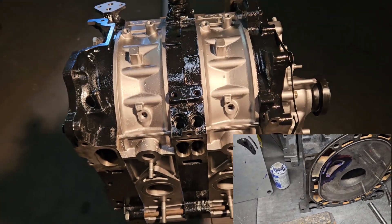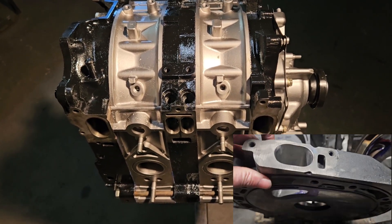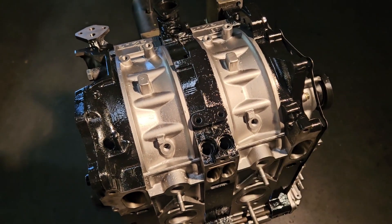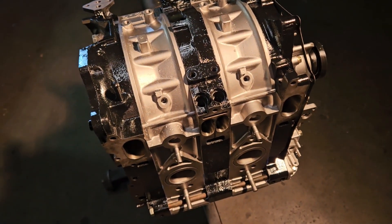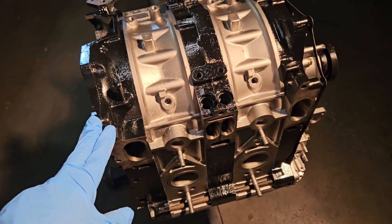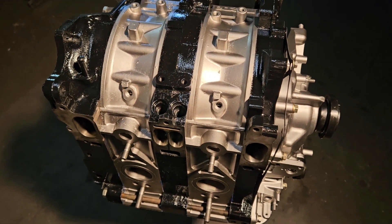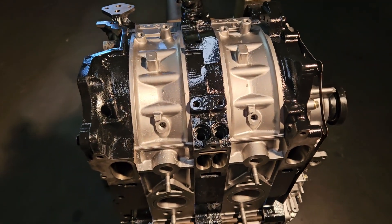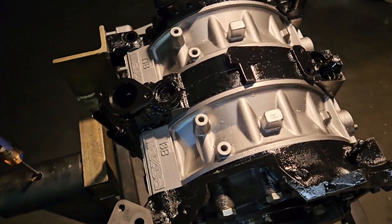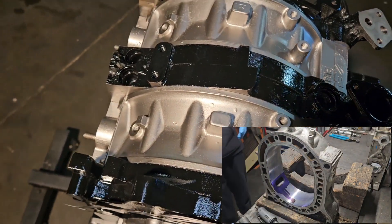On the internals, obviously new bearings, polished shaft. With the lightweight rotors and everything the way it is, I'd say it's good to 9,500 RPM. A lot of people would love to hear 10,000-plus, but keeping the motor reliable is the customer's concern. So we'd probably set this motor up with about a 9,500 RPM redline. It's still going to make tons of power with the right turbo combination. This thing would clear 600 horsepower no problem, potentially even up into the 700, almost 800 horsepower range. I usually don't see bridge ports on turbos go into the 800s — that's where semi-peripheral port territory really starts to take hold — but each have their trade-offs.